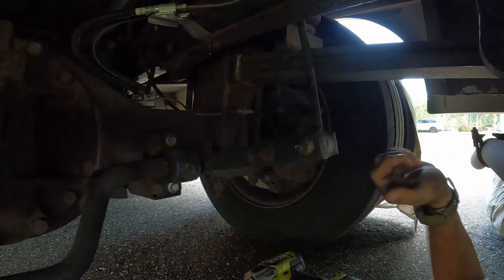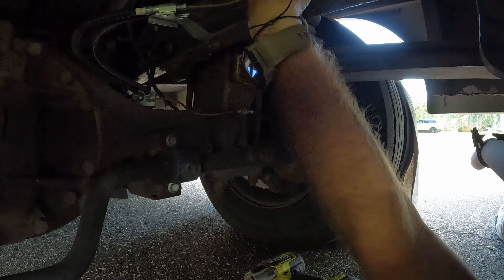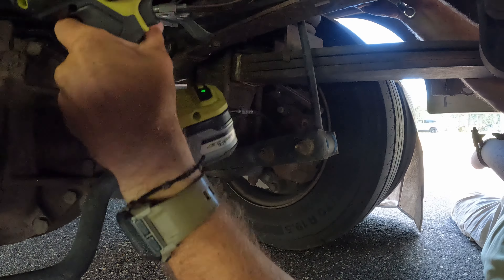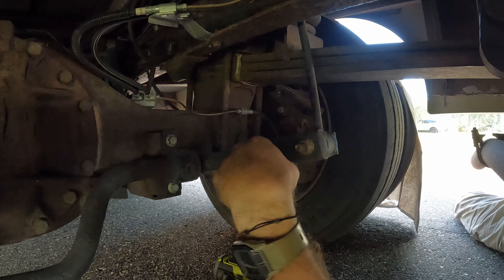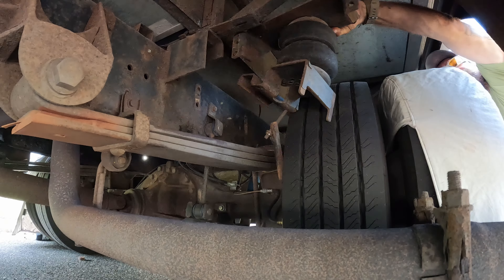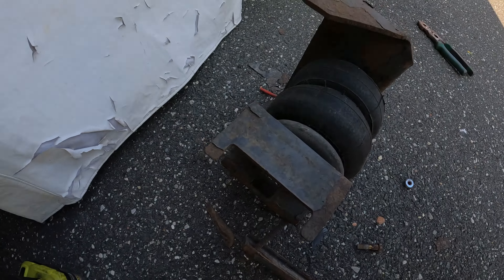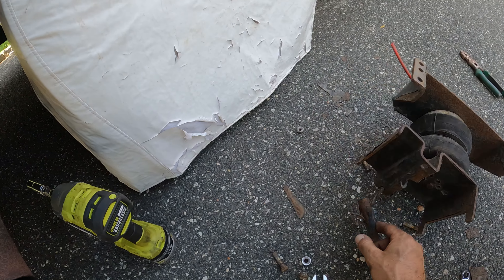On the driver's side you can see the airbag, the bracket with two bolts top and bottom, with the bottom bolt center at four and a half inches — dead center of the frame. The airbag rests on top of the leaf spring with two clamp bolts below. I'm going to release those clamp bolts first, then come back up to take it out. We have some clearance issues with the tailpipe and brake lines right there, so hopefully no problems.